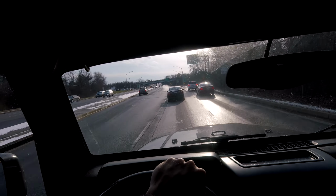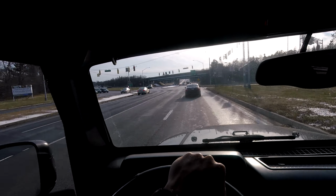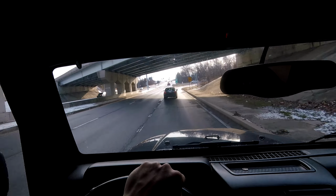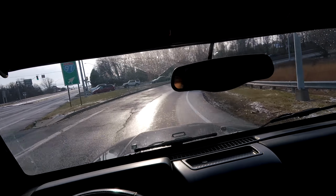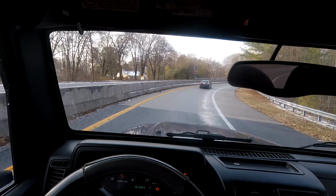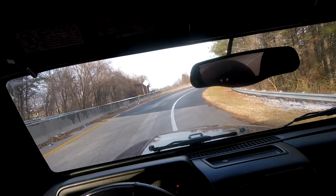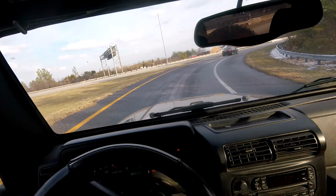As a matter of fact, when I went to finally put on the rear links, I'm like, holy crap, I don't even remember taking the rear links off. Where's the hardware? What does it look like? And of course I found it, but it's like, man, did I retighten all the control arms? I did, because I know I did that this morning, and I used paint pen to mark them as I did them, so I know those are all done. But did I torque the tires? I know I did that when I installed them. I always torque them to 100 when I put them on. You know, little things like that keep running through my head, and my goal is to not have this thing fall apart on me when I hit the highway. I think I got it all though.